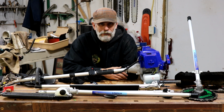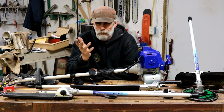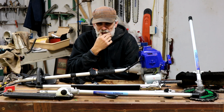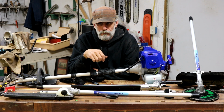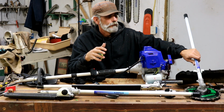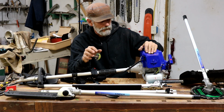Well, I gotta say I'm fairly impressed. I mean, here on the farm, our main weed eater is a 25cc Husqvarna. I also have a couple of Craftsman weed eaters. They're kind of junk, but they're older too, so got them used. Anyway, the Husqvarna does great, and I have a brush cutting attachment for it. But the brush I was taking out of that fence line, you'd have to hit it 2 or 3 times to get through a 1-inch piece. This thing was going right through it. Maybe in part that's due to the chainsaw teeth on this blade, because the other one looks like a skill saw blade on it. But still, that was this 63 cc's.